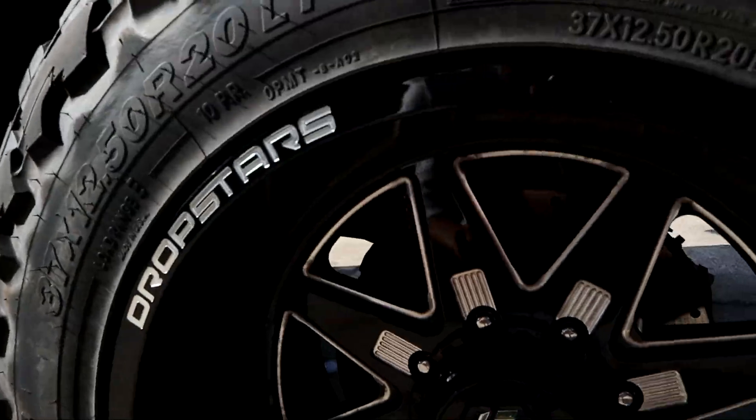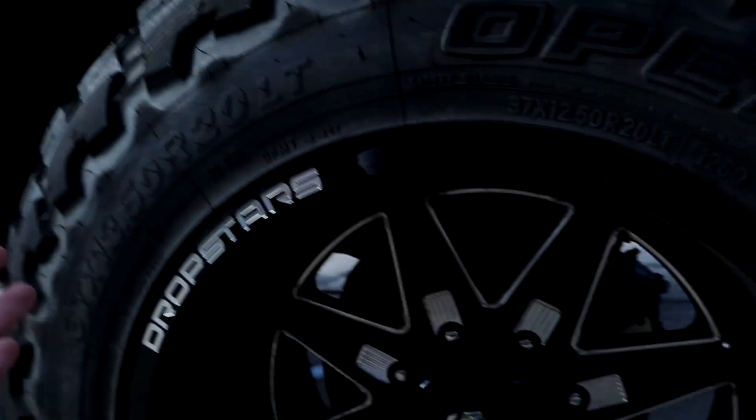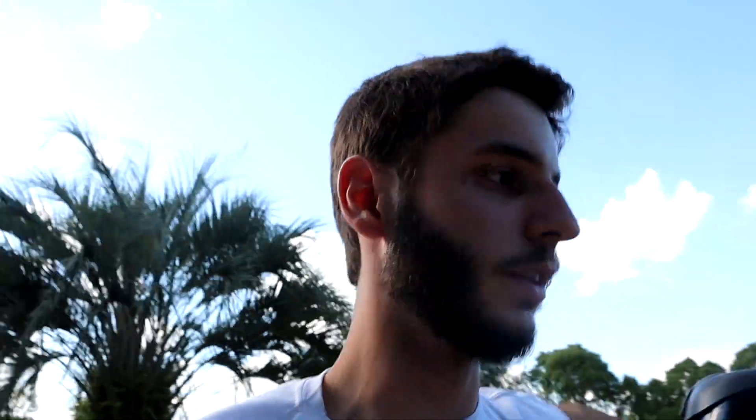One thing before I hand it over — I forgot to say what was wrong with the brake rotors. We had the brake rotors flipped around, so this rotor was on that side and vice versa, which caused it not to stop. It's surprising it makes a difference, but there's no way to indicate that's the case. Also, the rear brake calipers were upside down. What's humility if you don't embrace it, right? The bleeder valves are the only indication to show you they're the right way up — two small mistakes made us so confused.